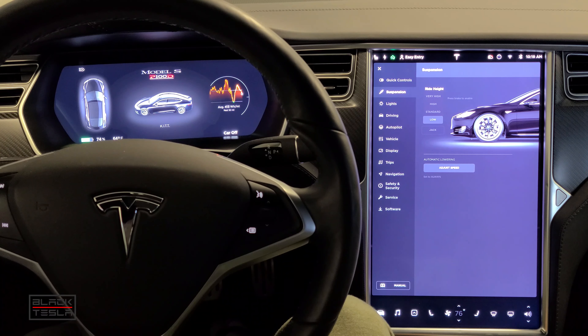You also want to go to your USB port and either remove your USB drive for the dash cam, or pause it by long-pressing the icon until you see it change to paused. This stops the car from writing to your USB drive. I recommend removing the USB drive — it saves the life of the USB or SSD you're using from being written over and over from whatever Sentry Mode picks up, and it also keeps energy usage low. So: Sentry Mode off, remove the USB or pause it as necessary. If you're outside, keep everything on and make sure your car is secure.